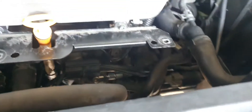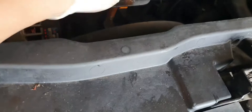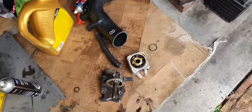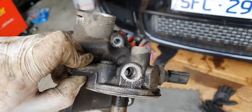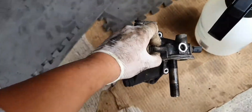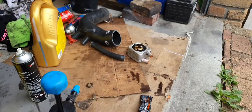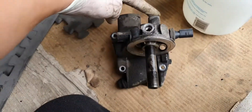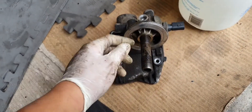That's the end of the saga — it is on. I'm pretty confident that it's gonna seal because it went on properly. I had to do a mod on this dipstick as it cracked down below, so I've ordered a new one, but until then it's repaired and sealed. This is the pain that caused me three to four hours delay. You gotta take a few things off — oil cooler first, then you can take this off. There's a few brackets, it's only four bolts. The last bolt is covered by the oil filter, so you do have to drop the oil and drop the cooler.